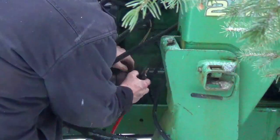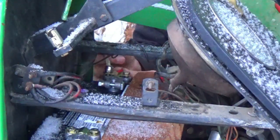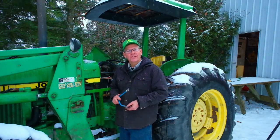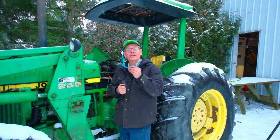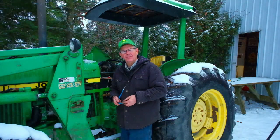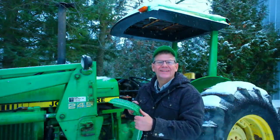With our positive battery cable installed, all we've got left is the ground strap. I was going to make another ground strap up and run it from the battery all the way back to the starter mounting bolts, but because we're running out of daylight I'm going to reuse this one for now. It's also a one-aught cable so it certainly has the ampacity — more than enough to do a good job — and it's in good shape. Obviously I've bought it recently and installed it. By recently I mean within, oh, the last 10 years. Let's put it on. I can't wait for the acid test.